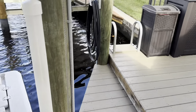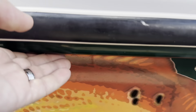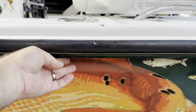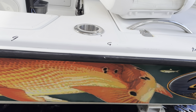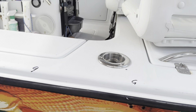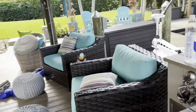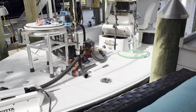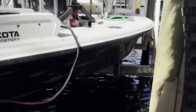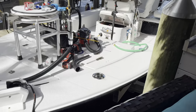this boat has a pretty decent overhang right here, you can see, and right back here, because this gunnel is pretty vertical, they cleared with no problem. Well, up here at the bow, they did not clear. And I had to cut the hole a couple times, reshape the hole. You can see all that angle right there really caused a problem.